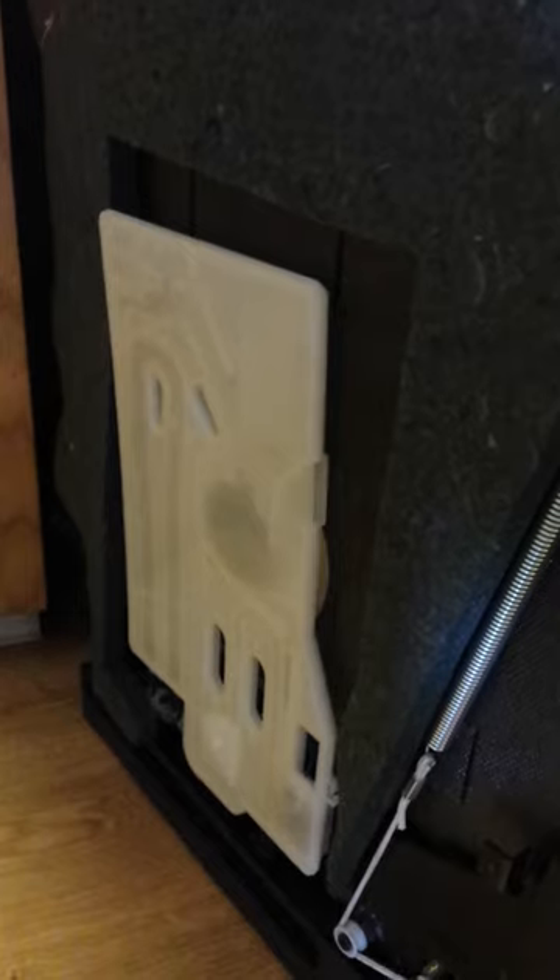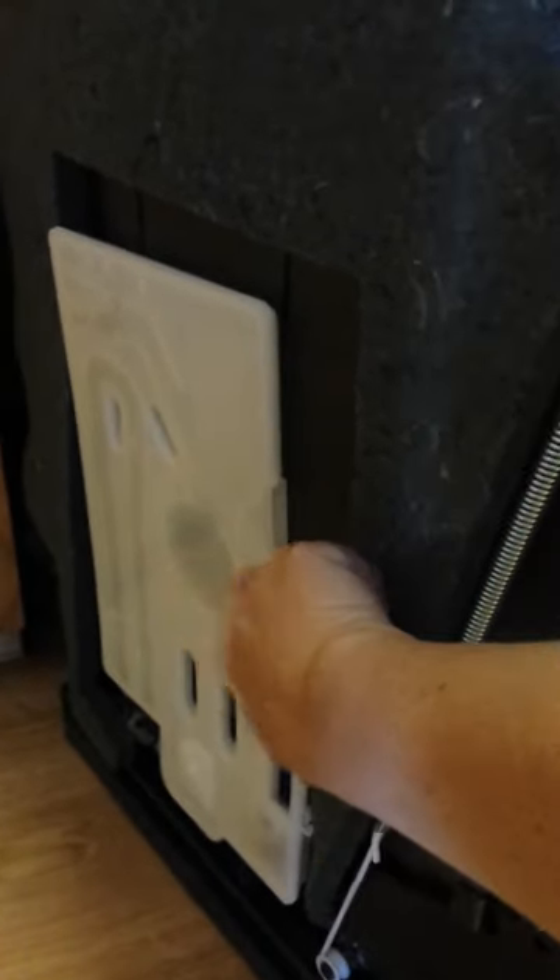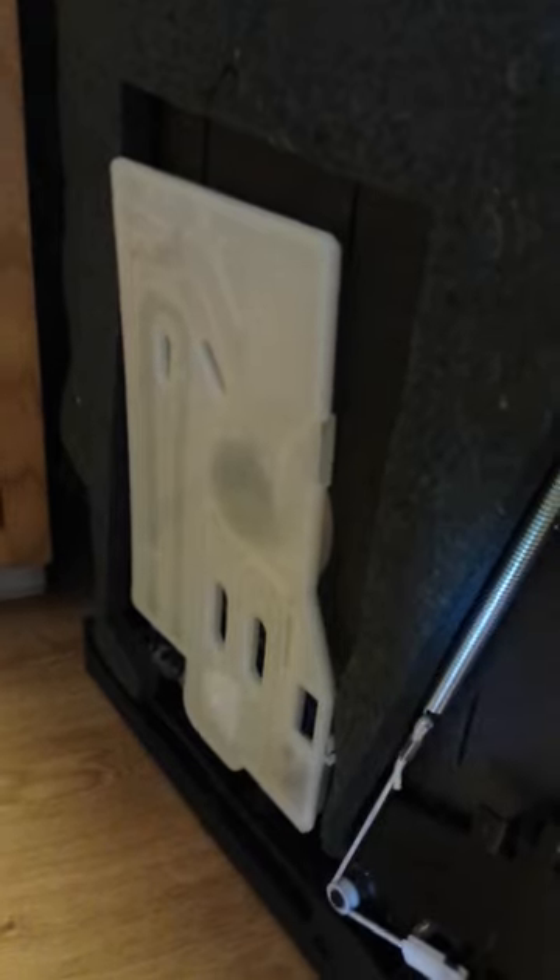So we worked at putting hot water in it, let it soak with some bleach and various cleaners. That took me about a day. I hooked it all back up and started it again, but this time it would constantly run whether it was turned on or not, trying to drain — which again was saying it was a water leak. So I took this out again, unplugged the two wire connectors that go into it, and let it sit all day until it completely dried out.